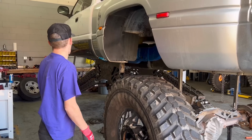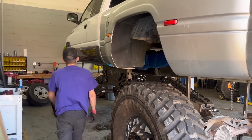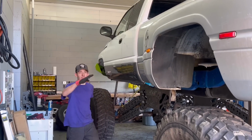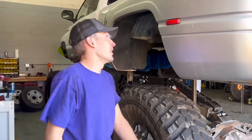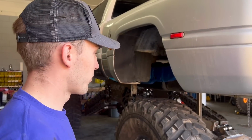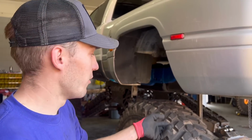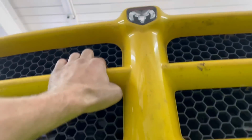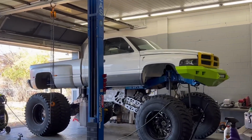But I'm gonna see how big this truck actually is gonna be with the back tires on it. It's a little tooted right now, but we're gonna change that. And I might do a bigger coilover in the rear. I should be able to go up to like a 16-inch travel shock from a 12 with the arms I have on the rear. I think I should have titled this video, oh, the world's biggest second-gen cock. Holy fuck.